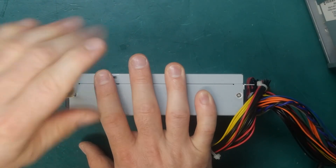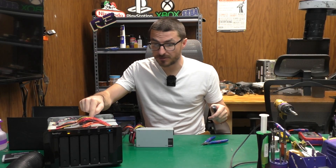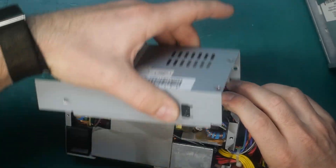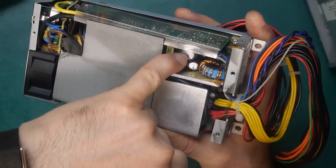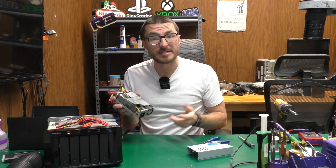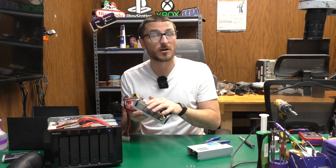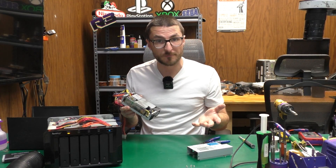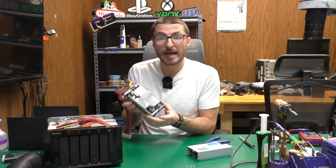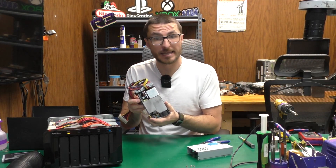While the unit initializes, let's open up the old power supply — a couple of screws on the side and one more here. I'm looking at the capacitors to spot any bulging ones; a defective capacitor is typically an easier fix, but that is not the case here. So I'm opting for a replacement power supply instead of component-level repair, since these are fairly affordable. The replacement I got on Amazon for $45 — I'll have links in the description. You can get cheaper ones, but a lot of those arrive defective, so a little more money ensures a working unit.